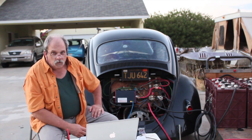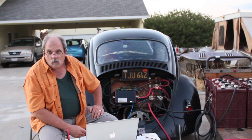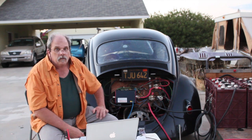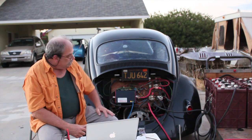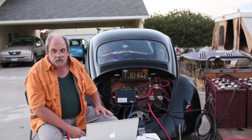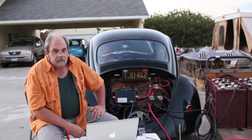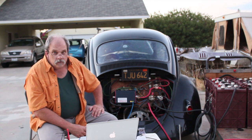I have an 11-inch Kostov motor — it's an older one, the older style, not the high-voltage style — that's why we're going to keep the voltage down a little bit. But it has a lot of torque. Right now we're just testing, making sure everything's working and where we want it, because we are going to move it into the red Volkswagen Roadster as soon as all this is ironed out. I do want to get my RPM sensor hooked up so we can have RPM limiting, especially with this bigger motor because it's not a high-RPM motor. We've been able to get rid of the onboard charger — don't need it with this controller because the controller is the charger. It is a high power charger and a high power controller.